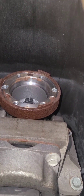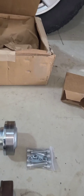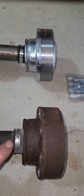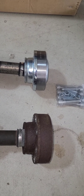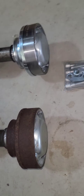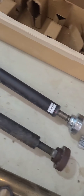I did fight the front yoke a little bit — had to get some PB Blaster up in there and give it a couple pretty good taps. On the old drive shaft, when you go to tap this out, this is all just some kind of thin pot metal — you will dent it and beat it up getting it out. Just make sure you're not wailing too much on the actual yoke on the car. Once you get the bolts out there's not a ton holding it in — it's just kind of sitting on both yokes. I'll definitely be driving this thing at the track every once in a while, and it's nice to see a quality aftermarket replacement part from Dorman.